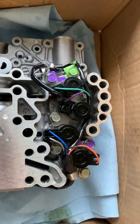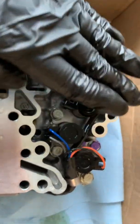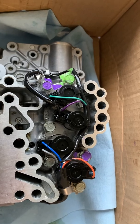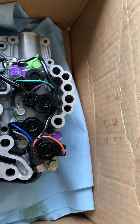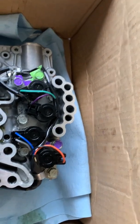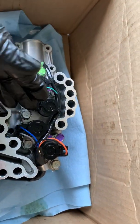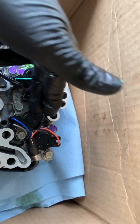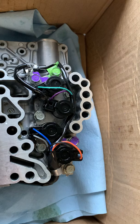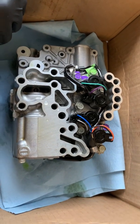Another trick with the hold-down plate and solenoids: there is a ridge you can't see because it's under the hold-down plate, but there's a slight ridge that shoots off to the side of these solenoids — kind of like a flat plateau — that sticks out to the side. That's where it grips the hold-down plate, so the hold-down plate goes over top of that. It's kind of hard to put these solenoids in the wrong way because if the hold-down plate lines up with the clip and the little ridge coming off the side of the solenoid, there's only one way it will fit down into the valve body. So hopefully this helps somebody — leave your comments and thanks again.